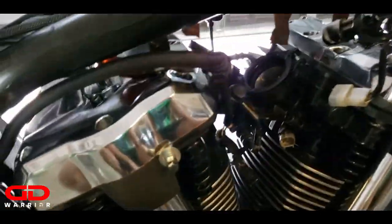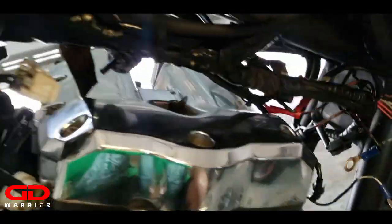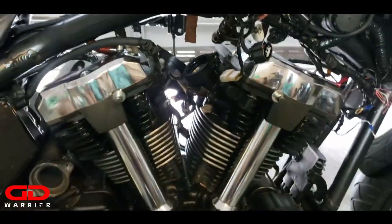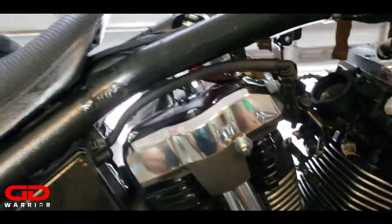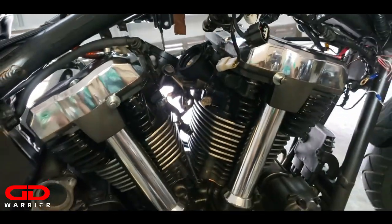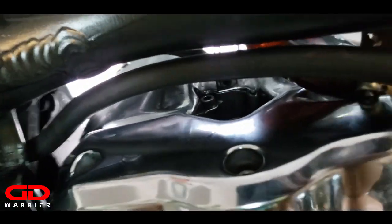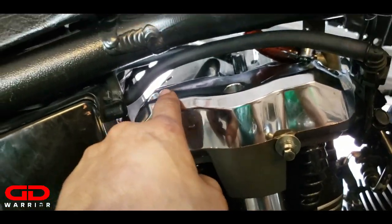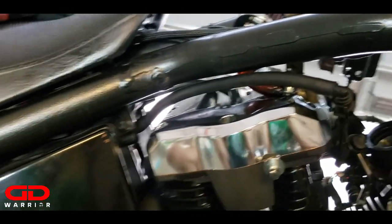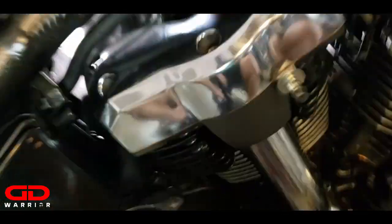We are so close. When you are done with your rockers, put the gasket on top, make sure your bolts are all torqued to spec, and then put your valve covers on. It's very time-consuming on the rear cylinder valve cover because the bolts in the back are very hard to get to. Each of those bolts is 7.2 pounds of torque.